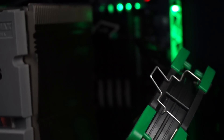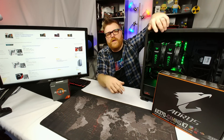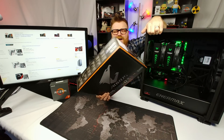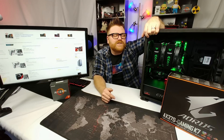I have four DIMMs — 32 gigs of Ballistix Elite 3200 megahertz memory — that I have not been able to get working properly on any other Ryzen motherboard. I've tested MSI Gaming, ASRock, the Fatality boards, Asus Prime, and a lot of other boards — even the cheapest X370 Gigabyte, which was total crap; don't buy cheap when going with Gigabyte. I was never able to get this particular memory to run at its rated speed — it's not Samsung B-die, I'll say that — and this motherboard does it. Just load the XMP profile and it will run at 3200 megahertz, no problems, no crashes, very very well.